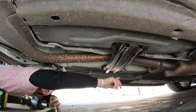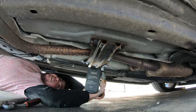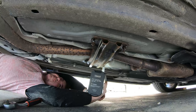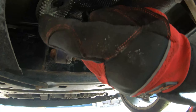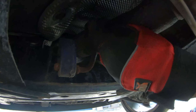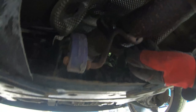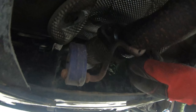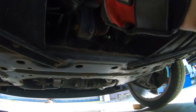We're now going to remove the centre brace — it is 14mm and it has four screws. That should come straight off. We're going to unbolt here and here, coming off the down pipe, and then we can take out the old exhaust.